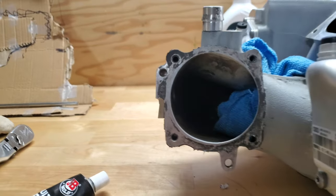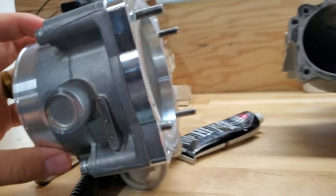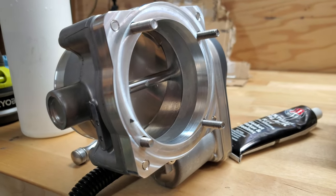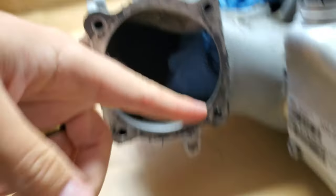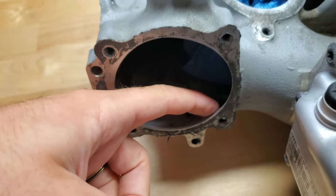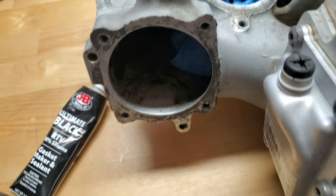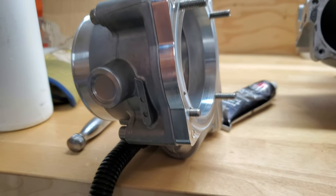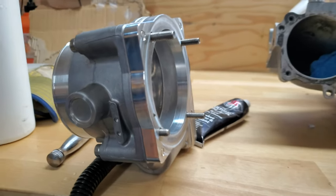So we've got the opening here and we've got the throttle body. You can see that of those four bolts, one is shorter. That's because when it's ported, there's not much material left on there to make that curve. So instead of putting a long bolt that would interfere with the airflow, we've taken the liberty of giving you the shorter bolt you'd need already, and that is plenty of thread. That's what we run and it's been a great success.